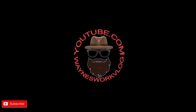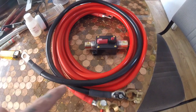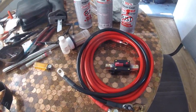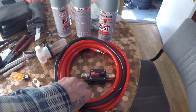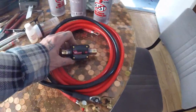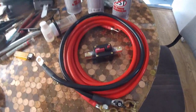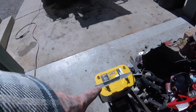The van sounds like shit, so my plan is to relocate the battery to the cargo area or all the way back to the bed — not real sure yet, but I got enough cable to do whatever I want. I also got a 300 amp breaker that I will put on the ground of the battery right next to the battery. Picked up a yellow top so I can run the winch even if the vehicle won't start.